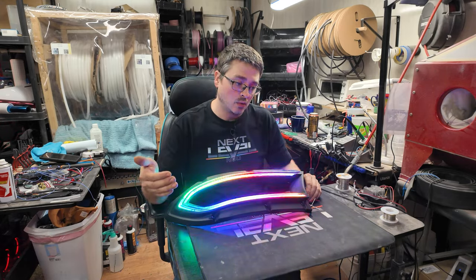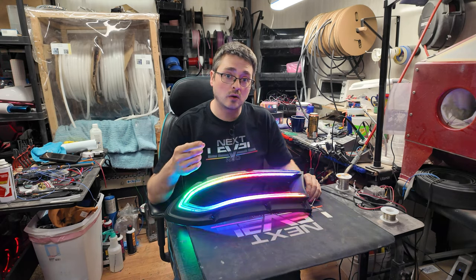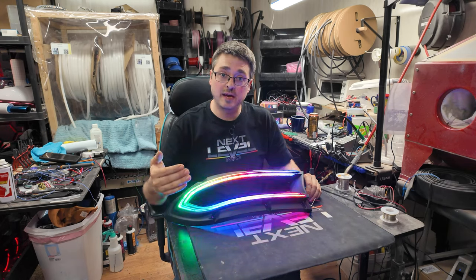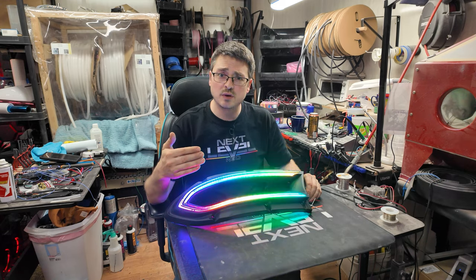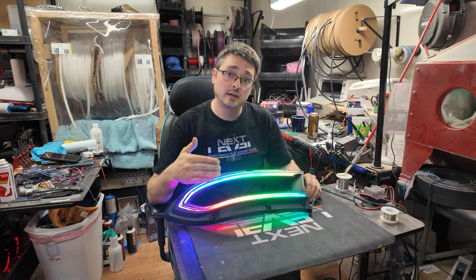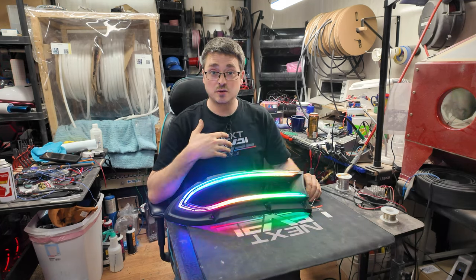So it will draw more power. That is one thing to keep in mind. If you're talking long-term at a car show, you may end up needing to have a larger battery or a backup battery, maybe a secondary battery in the trunk. Lithium is something I do recommend for a lot of people for show cars because it does generally run a lot longer at a show. I run lithium on my show cars.